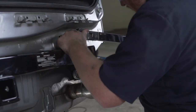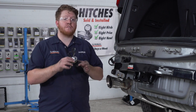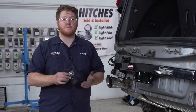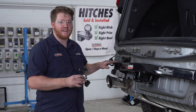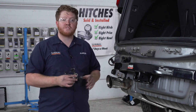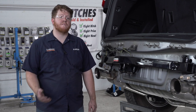Now that we have our hitch installed, note that if you are going to be towing a trailer, trailer wiring is required by law. You do have a pre-wired plug right here on the driver side — it's super easy to install, all you have to do is plug it in. If you want to follow those instructions, check out our in-depth wiring video on the link coming on screen right now. With everything installed, we're going to reinstall our bumper fascia in reverse order.